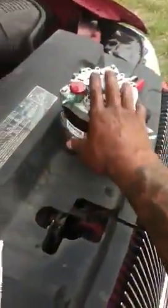On these right here, there's this bracket here. Take these four bolts out. I already got the belt removed, as you can see — serpentine belt. Just remove that. It's real easy. A lot of people don't like doing these on here, but they're real easy. About to put the new one on now. That's the old one — take the old one off.